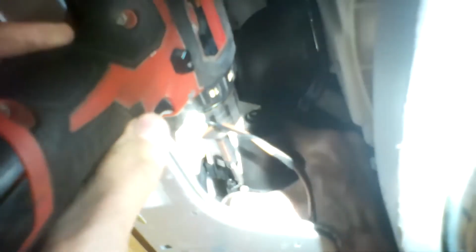I'm going to pull that one out, and then there's one on the other side of the pump, which is a little bit harder to see, but you can grab the pump and twist it because it's being held on by 2 hoses, so it's a little bit pliable. You can twist it more towards you so that you can see that other Phillips head screw. See if the camera will pick it up here. There it is. So once you get that screw off, the motor will come off, and it's really easy to pop on a new one.